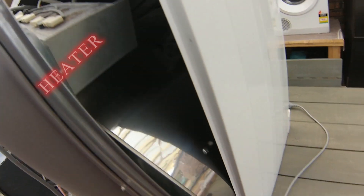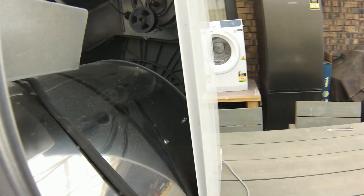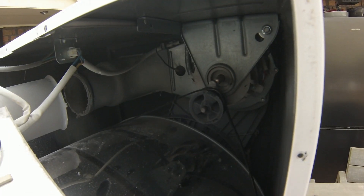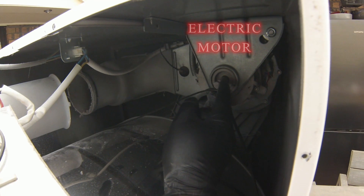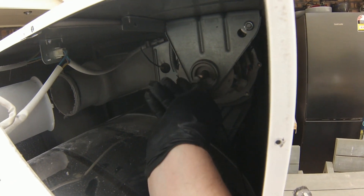These are the heater over-temp sensors or thermostats — they will go open circuit and trip the heater elements if the machine gets too hot, but they're working fine on this machine. It's the drum that is not spinning. I've already reached in and removed the belt from the motor, and giving it a quick spin by hand — this motor is free and spins easily with one finger, so the bearings are good.